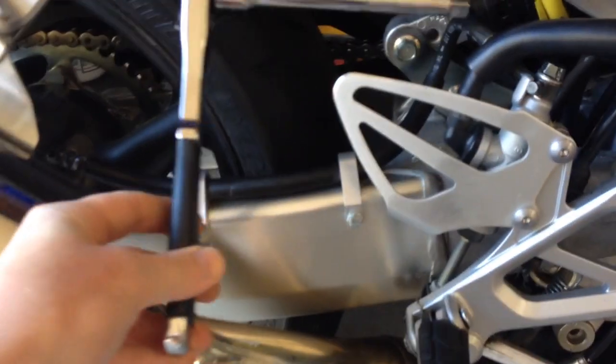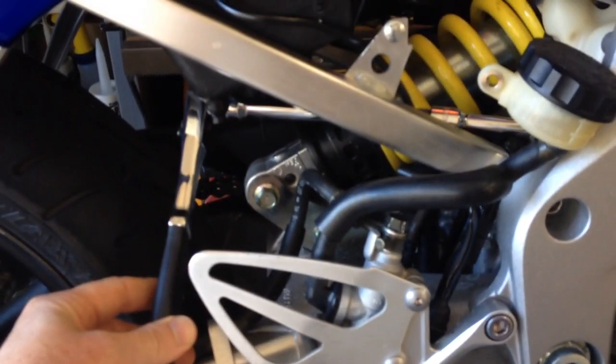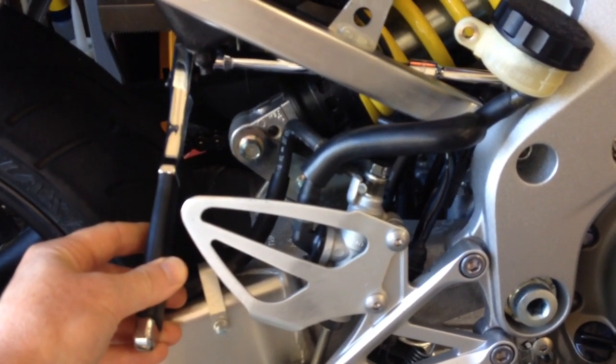You can see me moving it there, as straight as possible up to the 2 bolts on the cam chain tensioner. And with this laying here like this out the back, and with the brake fluid reservoir out of the way, it then allows you to take one more extension and a standard ratchet, put that on the end there like this, and the nice thing is then you've got your hand free to rotate. You've got almost 180 degrees of rotation here.